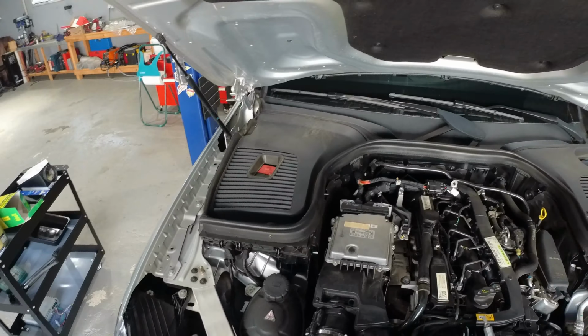You just need to push it to the front here in the plastic. Now lift it and push it away. You have these 2 tabs here that insert in here, so it will pivot right in there. Now with the filter removed, I like to vacuum clean the box. With the air box clean, we can now install the new filter.